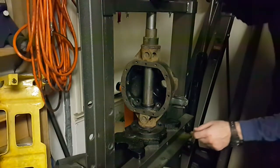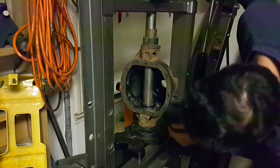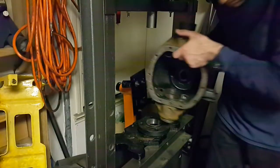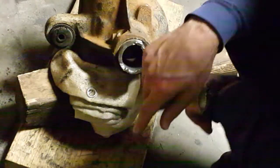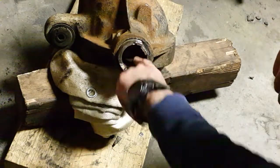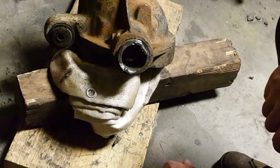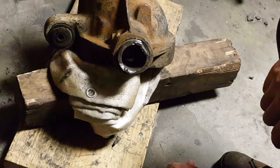It's not moving, and I'm pushing quite hard, so I'm a bit concerned now. Someone in the Jeep forum chat made a suggestion that I weld lines up the sides here. When you weld like that you actually cause the thing to shrink. So I'm going to try that and see if it presses out more easily.